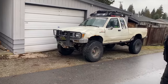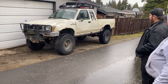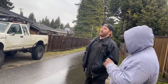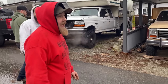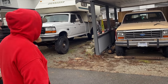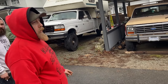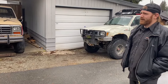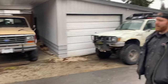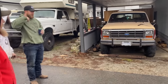Fire it up, burn out! It sounds like shit right now - it's got 17 exhaust leaks. Did you regear it? No, it's 410s, it's open. I'm hoping to get the 4x4 working on that Jimmy so we can just go. I had a Blazer and I'm pretty sure I know your issue. It's probably the vacuum actuator underneath the battery tray. If it's not that, then it's probably the switch on the transfer case. Both are super simple and cheap. We need that all-wheel drive for jumps, rallying, whatever. I'm bringing my helmet. No roll bar, helmet for sure.